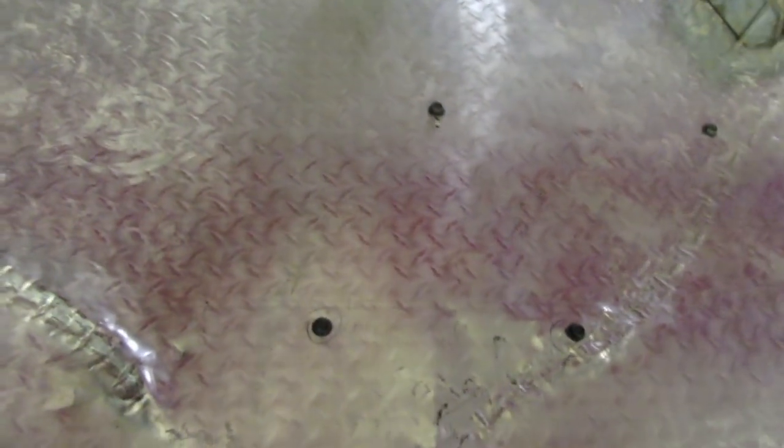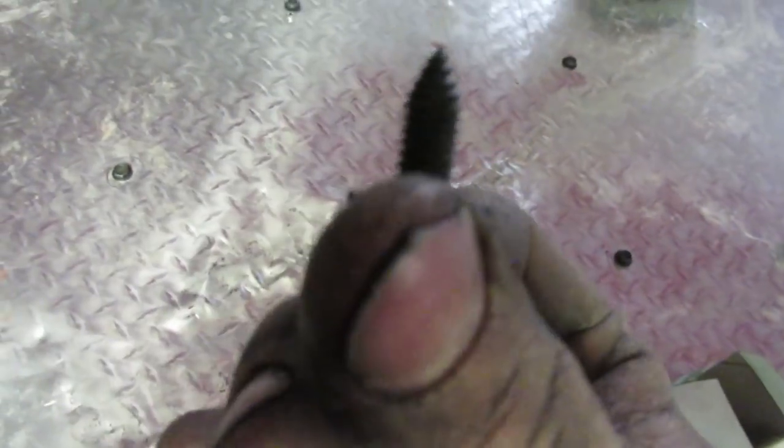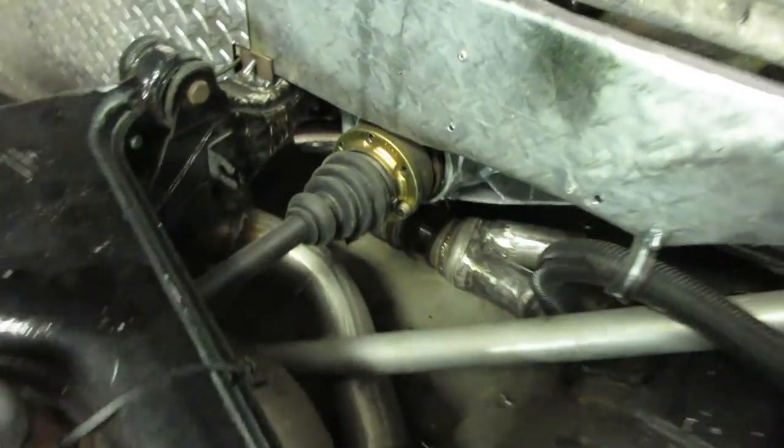Basically this is the full skid plate underneath the car. I just replaced the wheel bearings — ordered new ones but they were the wrong ones, so the right ones are coming. I lined up a level front to back, then self-tapped holes with these little self-tappers, which marks the hole in the plate and in the runner. Then I throw these speed nuts in, slide them in, and use these nice tapered bolts that find the speed nut real nicely and hold it down good and solid. It'll vibrate, make lots of noise, scare the hell out of you.